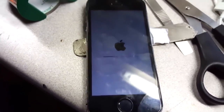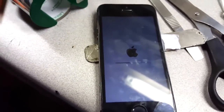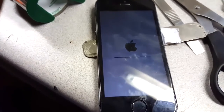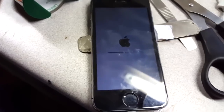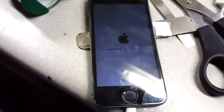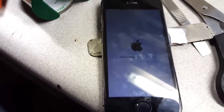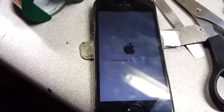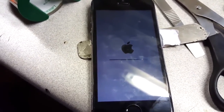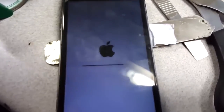I'm not gonna pause the video anymore so you can check that I'm not lying about this. The only thing is you have to wait for a new update to come out, and it's only gonna work if you put it in restore mode, not DFU mode, because if you put it in DFU mode it's not gonna give you the option to update the iPhone.